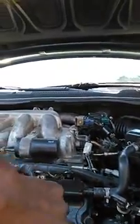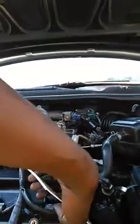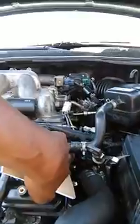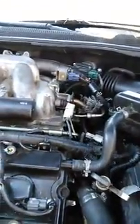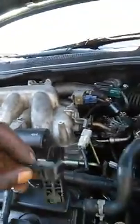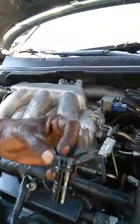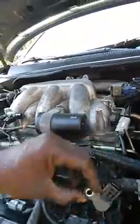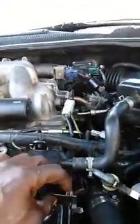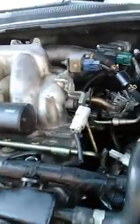There are two specific camshaft position sensors and I'll show you where they're located. The left-hand one is located on the front cylinder here, right above the radiator intake. There's a screw there and the clip — it is bent. You can see it sits in there like that and the clip comes down into it.